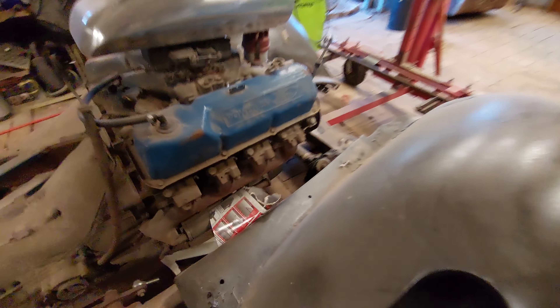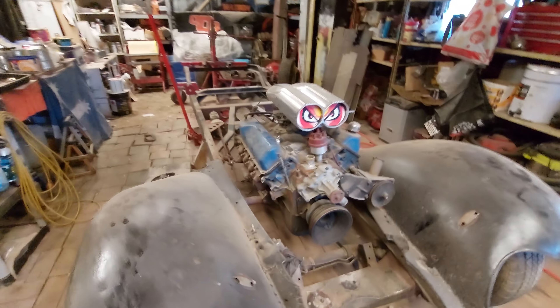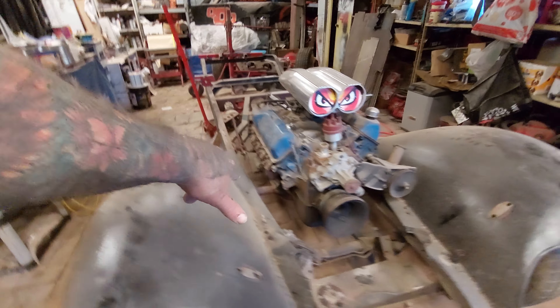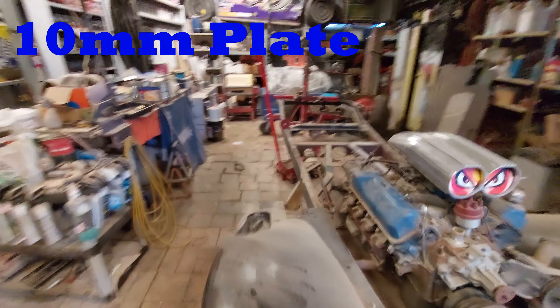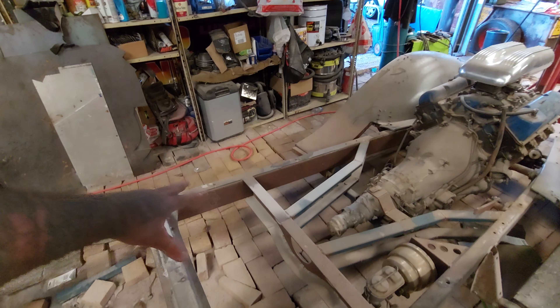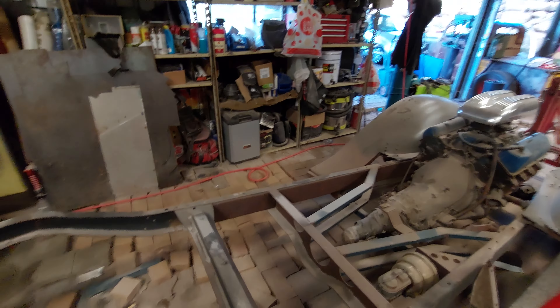Now a lot of this still needs to be welded out — it's just stitched on. We are tidying the shed finally. As you can see we have the pipe going underneath the engine mount, so the cross bracing there, and that is boxed in with an extra plate — from memory that's a four-mil plate, folded into a C-channel for the boxing through that section. It's part of the rules in Australia that the chassis has to be completely boxed with three-mil, so we've over-engineered it — done with four and it's been C'd in. None of that's welded though; it's just stitched, pretty much all of it is just tacked together.